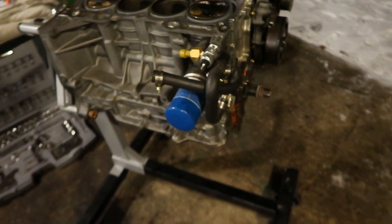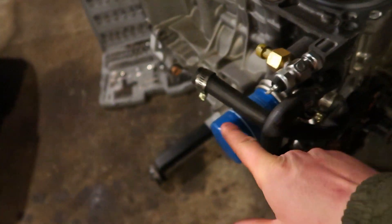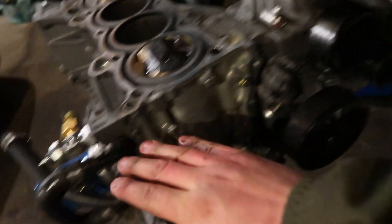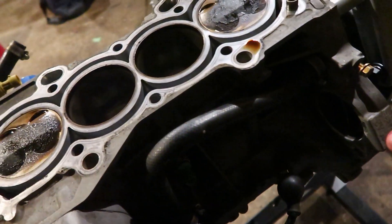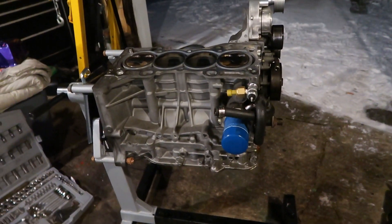It's getting a little chilly, so I'll pick this up with warmer clothes. Next up: take the oil cooler off — I'm going to put it on the K24 and use the water pump, since that's the only way to use the oil cooler. Then take off the thermostat, alternator, and everything else. This'll be a bare block — I'll probably see if someone wants to buy it and build it up.